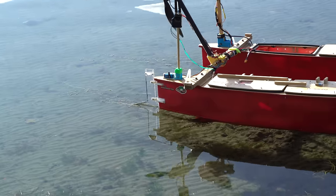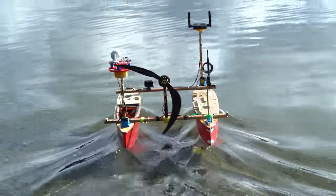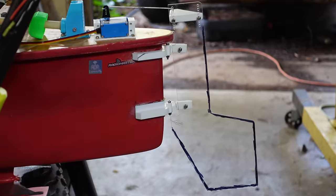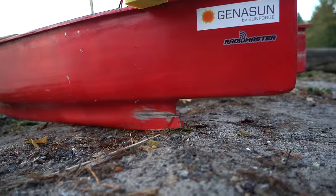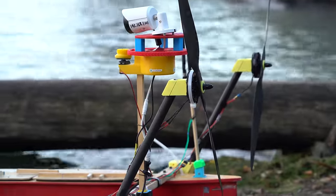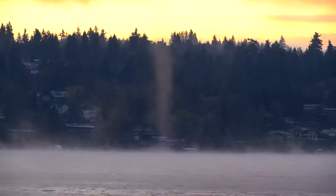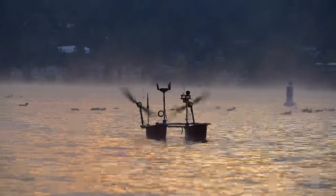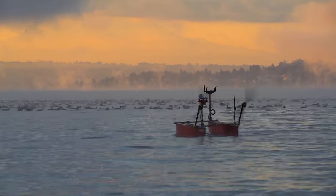Nothing's worse for efficiency than towing around weeds, and I just can't get away from them — they were stuck on the rudder and the prop protector fins for the old underwater props. So I went home, took the rudder off, cut the fins off, and sanded the holes down smooth. Then it was back to the lake. But how am I going to steer without a rudder? Differential thrust! I added a second propeller, so now we have double the disc area, which is even more efficient than before. The dual air propellers worked great — no surprises — and now there's absolutely nothing on the bottom of the boat for weeds to get stuck on.